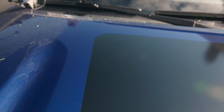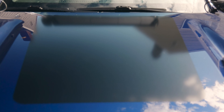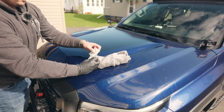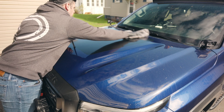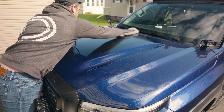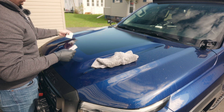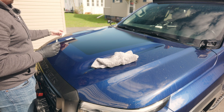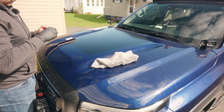So this is handheld just to show you guys how this vinyl came out — it's pretty good. It says you might need to use a heat gun; I didn't have to in this case. I was able to squeegee out any air pockets or imperfections. Next up is going to be the adhesion promoter. Per the directions, it says an inch and a half around the perimeter of this vinyl is where you want to apply it. I've never used this stuff but it did say to use gloves.